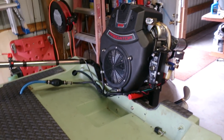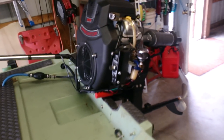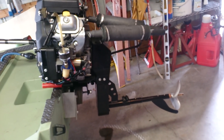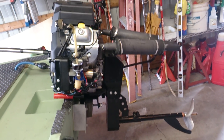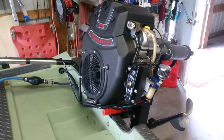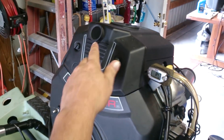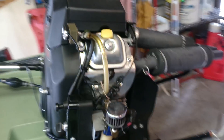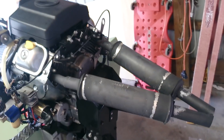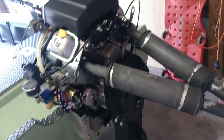This video is about a 670 Predator engine on the new Mudskipper surface drive unit. A little bit about the motor — it's been modified. The governor's been removed, there's an airbox modification to get a little more air in, the carburetor's been jetted up a couple sizes, and there's a custom exhaust on there. These things really helped the performance of this motor.